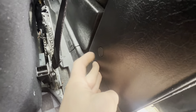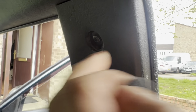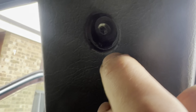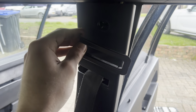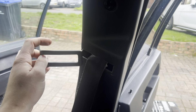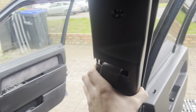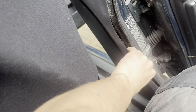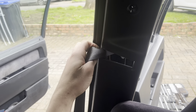First step is to remove these pillars — there's just the one clip here and one down there. These little plastics are a pain, but they pop out with a tool. Then there is a T25 bolt. Once these bolts are out, the plastic slides out — it has a slot for the seat belt — and then you just need to pull the trim off very gently and feed the seat belt through the slot.